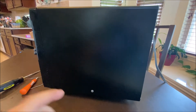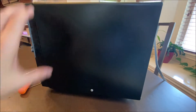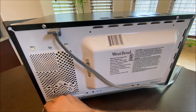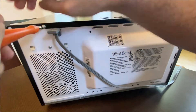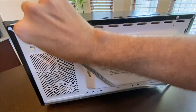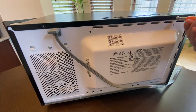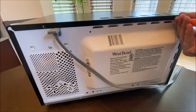The first thing you're going to need to do is remove some screws on the outer casing of the microwave to be able to pull this off and get the panels out of the way. Usually at least one if not more of these screws are going to be security type screws with a little post in the middle that prevents you from easily getting them out. A T15 Torx driver will work just fine — I also found a Gen 3 Ring doorbell screwdriver works exactly in those holes to remove the screw.